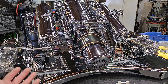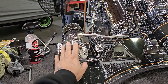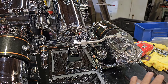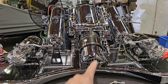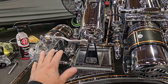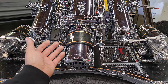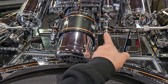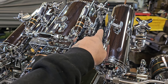Here's a show-and-go setup — this one is a two pump gravity fed. So we got our gravity fed pumps here. Left is always left, right is always right. These are the actual tanks that feed this pump, but we put it in line with the main piston in the front to give it a more aesthetically pleasing look. We have a piston going to the nose — one of our Hoppos pistons, half inch port, dual three-eight side returns. We did dual three-eights Stoochie check valves and dual Stoochie check valves on the top as well. We're running these all out on our zigzag dumps and also our zigzag slowdowns.